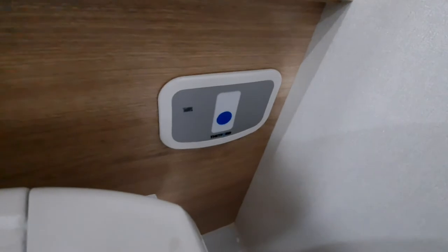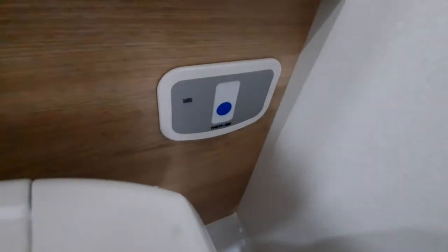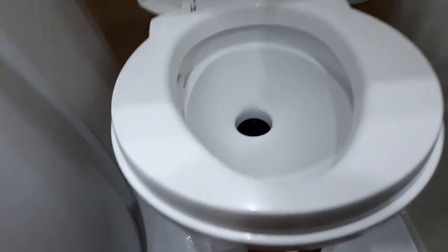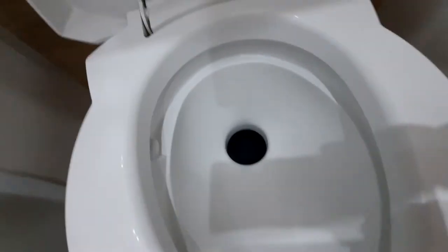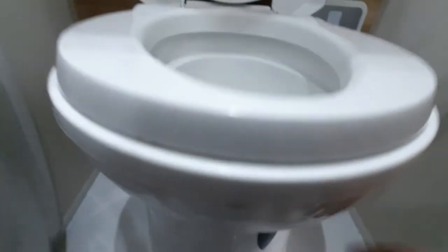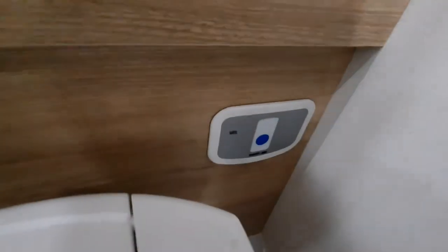Through into the bathroom area — with the toilet in place you have a flush button which is a blue button, and an indicator to tell you when the toilet is full. You must make sure that the blade valve — that's the valve inside the toilet — is closed when you're trying to pull it out. Close it by sliding the valve to the left, and right to open it. When it's full you'll have a little red indicator just there.